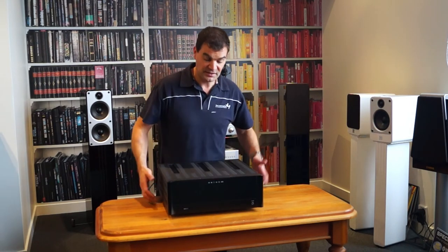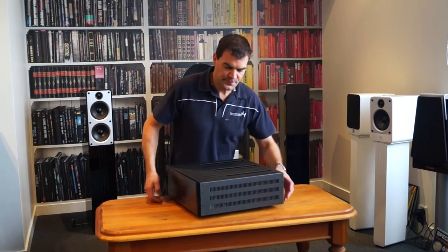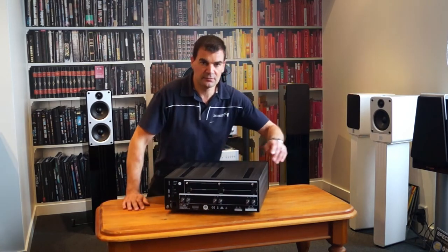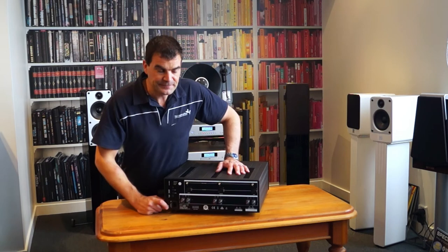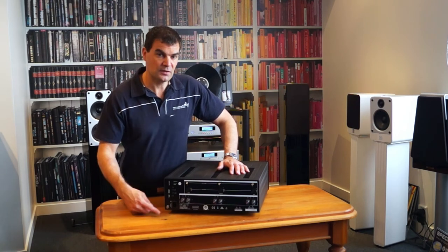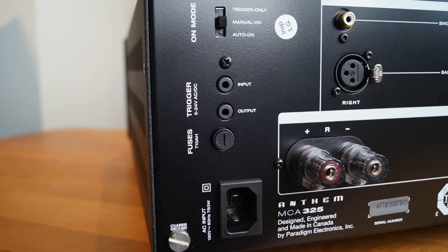The power supply is in the front of the unit, making it easier to pick up and tip forward, though overall the weight is very heavy. Spinning it around, you can see the large, thick, bent steel top and the rear panel where everything connects. The main IEC power cord is the first thing to connect. Off to one side is a unique grounding point — quite commonly with power amplifiers, hum may be induced when the earth potential differs between a source component like a theatre amp or processing preamp, and this gives the ability to bind those grounds together very easily. Above that is the fuse and trigger control, both in and out, for the ability to turn on a theatre amplifier and cascade to turn on other power amps or a processing preamp.